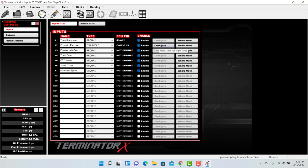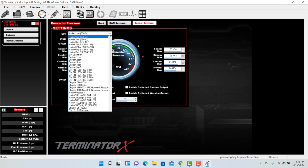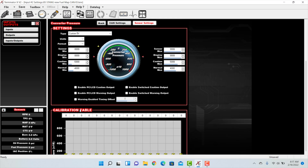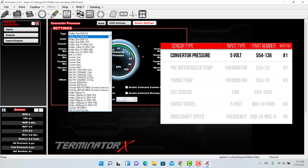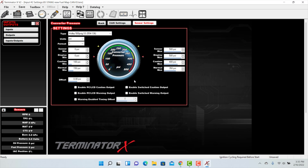Our configure button should highlight — let's go ahead and click on it. On the sensor setting screen, we can set our configuration. The great thing about using Holley race pack sensors is that most are already pre-configured in the software. We can select our sensor from the drop-down menu and be done with it. If you're using a sensor not on the drop-down list, you can select custom 5V to enter custom parameters. For our pressure transducer, we use part number 554-136 — go ahead and select it, and it automatically loads the calibration for that sensor.